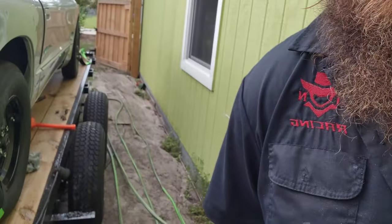This rain done wore me out, and yeah, little shenanigans. That Harbor Freight tool ain't worth nothing if you don't bolt it down, and I wasn't about to bolt it down in the driveway. So I would recommend, because I had to do this anyways, just threw the rim on the ground and jumped on the tire. So I'm just sitting on it, pulling the hose, if y'all are wondering what the heck, but just put my knees on it, put my weight on it, and just use the bar, and that was enough to get it on there. Live and learn, you know.